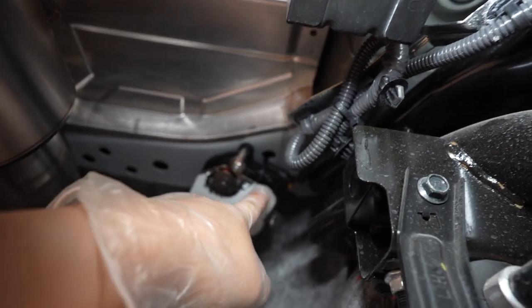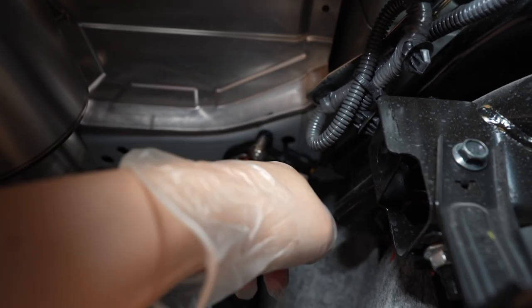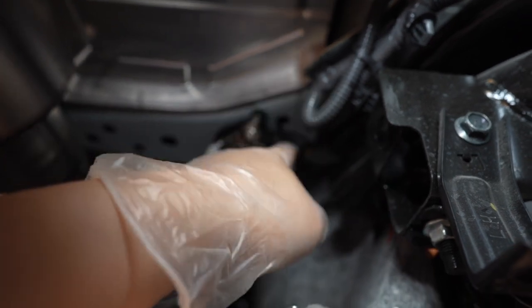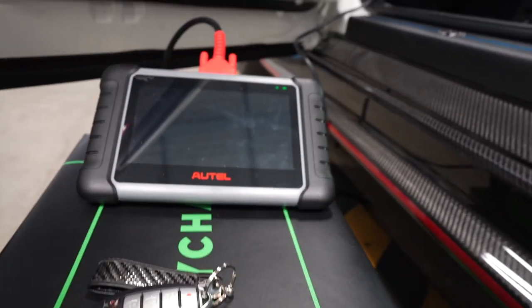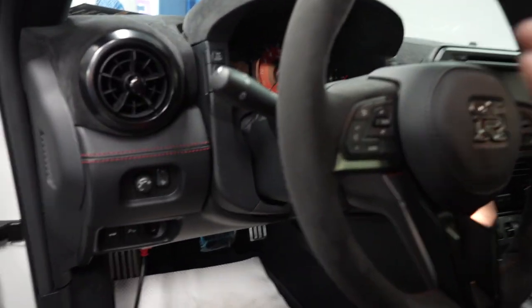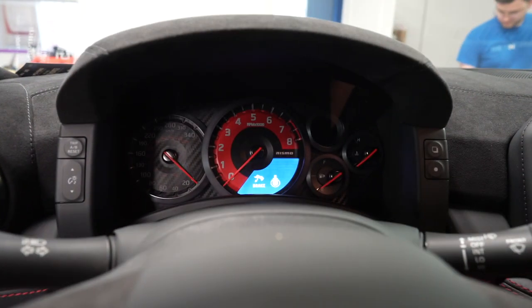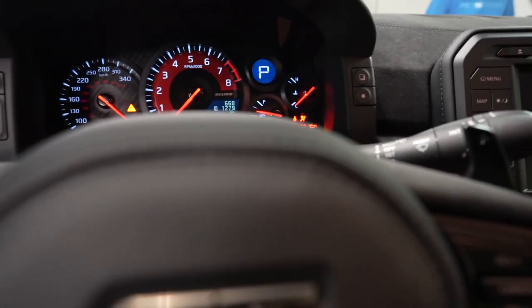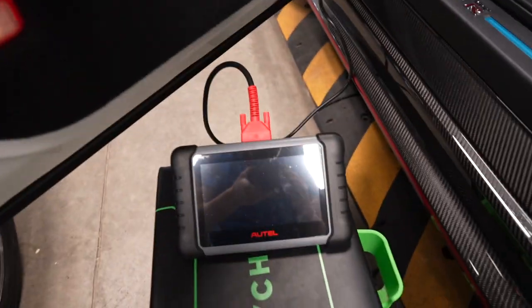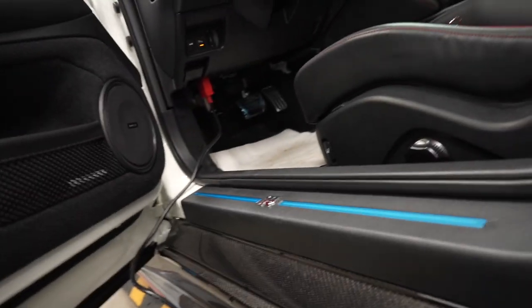All right, guys, so the factory valve is right there and it's conveniently zip tied. So I'm gonna go ahead and cut it off and unplug the module and let's bring it out. Initially, whoever installed the exhaust system either didn't do the valve adjustment properly or something went wrong. Obviously it triggered a check engine light. Grab the key here. So the car goes into limp mode now. What we're gonna do, as per the instructions, is clear the code first